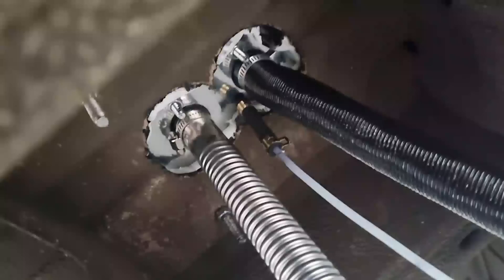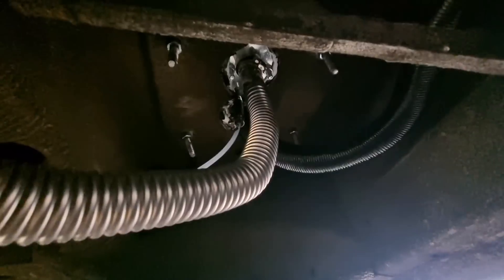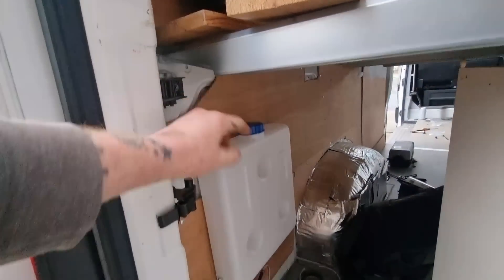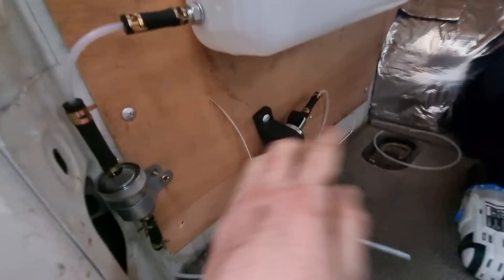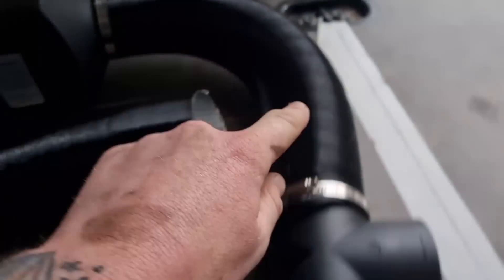The floor does bounce up and down, so I'm using fire-resistant sealant, packing loads of it around there and dropping it straight in. We made sure it was nice and secure, bolted in really solidly, and left it to cure overnight. We fastened the exhaust underneath facing towards the back of the van and the air inlet towards the front of the van, and ran the fuel hose along the brake line hose throughout the length of the van.